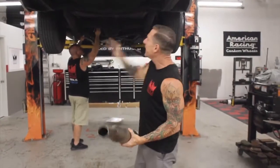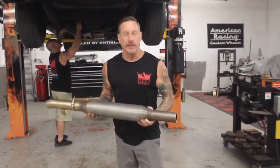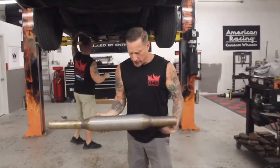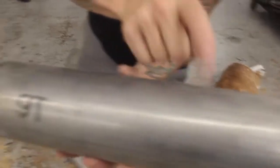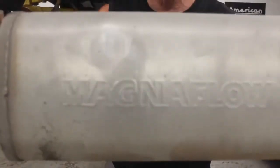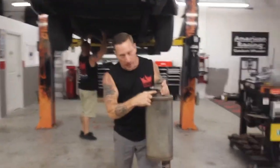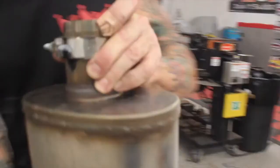Today we've got the Master working on a 1965 Rolls-Royce. This came in for a variety of problems, not the least of which somebody installed an aftermarket exhaust system — a very expensive one — using a Subaru resonator and a Magnaflow muffler. The client wondered why it was so loud. There are signs of leaking around the clamps everywhere, and the black carbon indicates the car is running very rich.